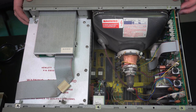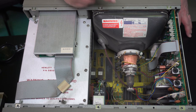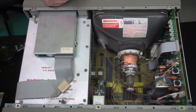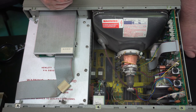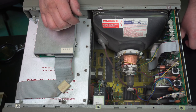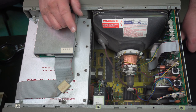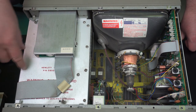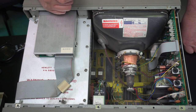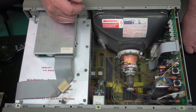So anyway, that's what it looks like inside. Now just a matter of warning — these kind of retro devices didn't spend very much time thinking about how to protect the human being. This is the TV section, and those that haven't worked with TVs — they're not the same as LCDs. You can actually have high voltages in the circuitry of a TV of its age, and you have the TV control mechanism on the side there.